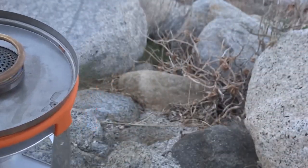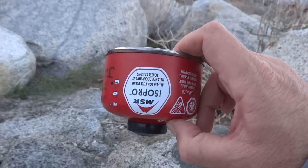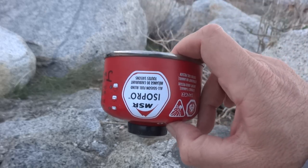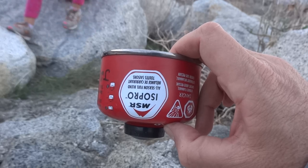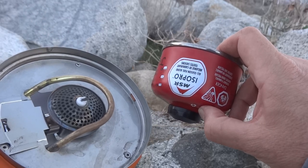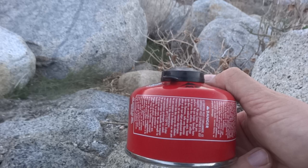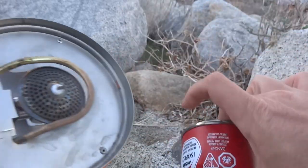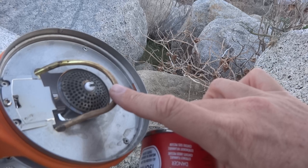When you turn a canister upside down, if you shake it, that's liquid in there. And if you turn it upside down, the liquid is feeding out through it, and that liquid feed, when it goes through this tube, is vaporized, okay? So instead of the normal having it vaporize in the canister when it's in the upright position, you're pouring out liquid and it vaporizes here.